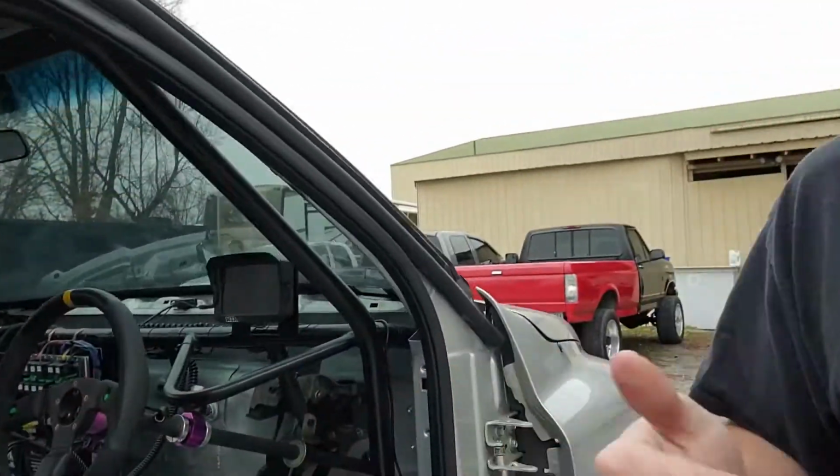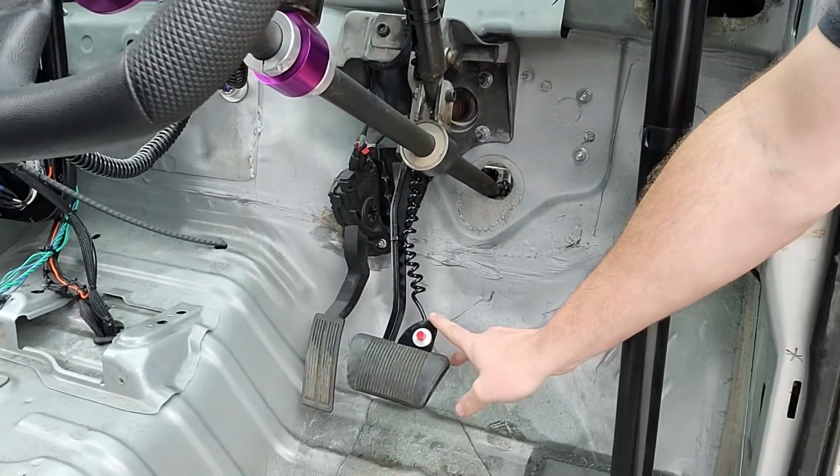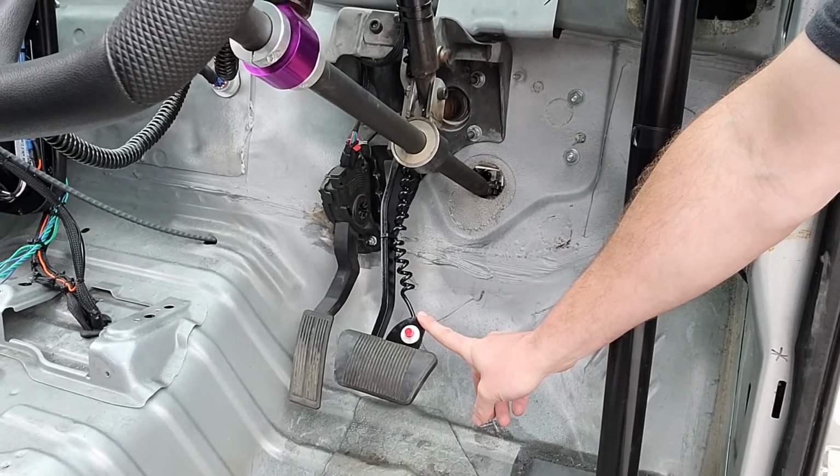Check it out here, he's got a button on his brake pedal. So we got that for the staging limiter. He can come up, get on the brakes, stand on it, floor it, hit his spool, truck comes right up. Problem we're having right now is he's got Innovative brakes on it. I think maybe the rotor's glazed over a little bit from some of his street driving, and it won't hold. So not really anything we can do tuning-wise. We know the limiter works. It comes up super quick. So no problems there. The biggest thing is he just needs to get it home, get it running.